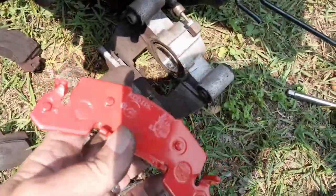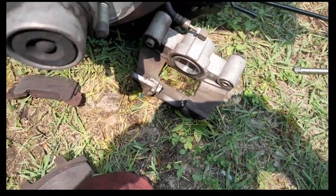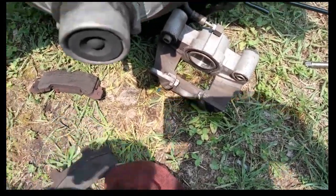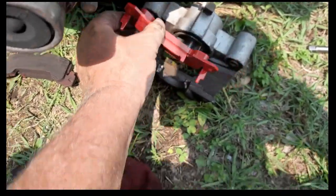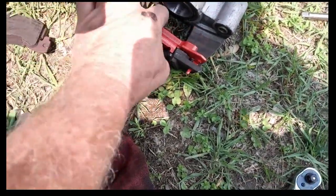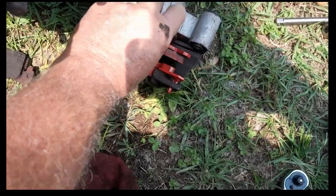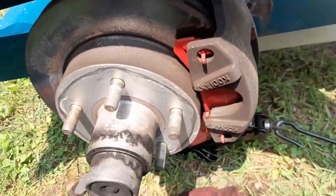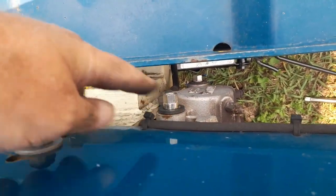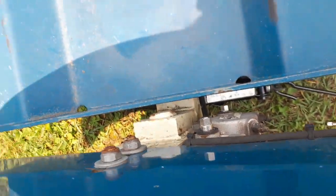Now do this one first because it's got the hooks. I cleaned it up a little and got some of the brake dust off. This goes in basically curve side down — those two horns go straight down. Always curve side down, because this is that direction. Put it on top, get it lined up, and push it on. Then get these screws back in and tighten them up, and that part will be done.